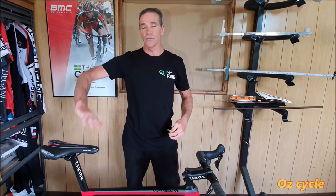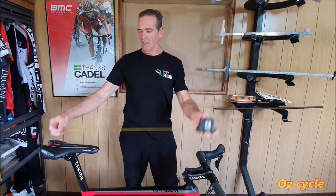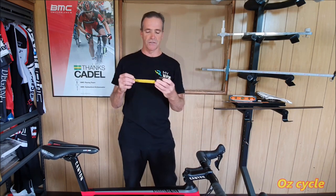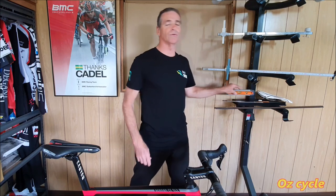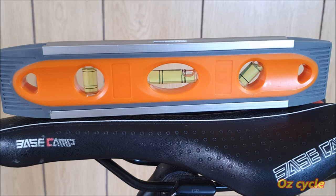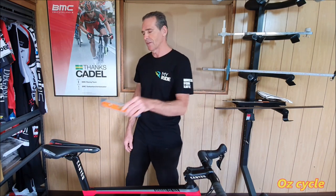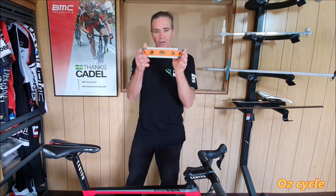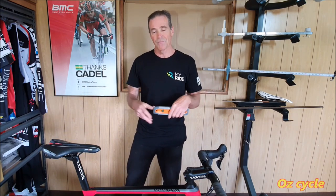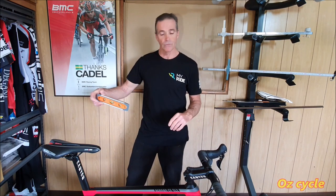The other thing is, with your seat tilt, how do you measure seat tilt with a tape measure? Because your tape measure is bendy and you need a straight line, so you can't use a tape measure for that. So you resort to the bubble level — you put it on your seat and eyeball it. Usually there are some marks on the glass cylinder and you can see approximately your seat tilt. However, this will only be effective if your floor is perfectly level, and pretty much 99% of the time the level is not going to be the same front to rear.